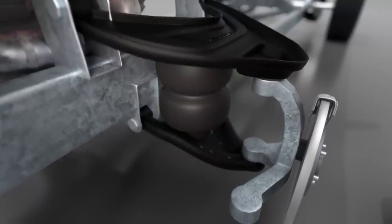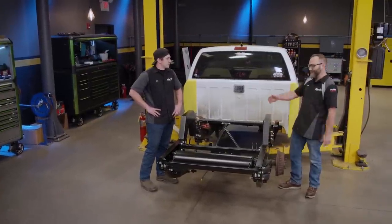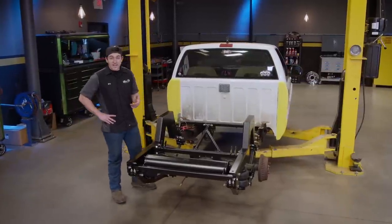Inside the bed will be the air suspension supporting components like the compressor and tank. Up front, we're going to be modifying and plating the A-arms, ditching the springs and shocks, and putting in air springs instead. Once we install the bags, remote shock mounts will finish it off. But there's something missing back here still — it might be a bed. I still have some stuff I need to do on the bed, so I'm going to go work on that now.